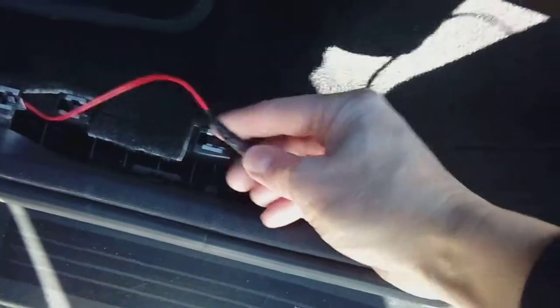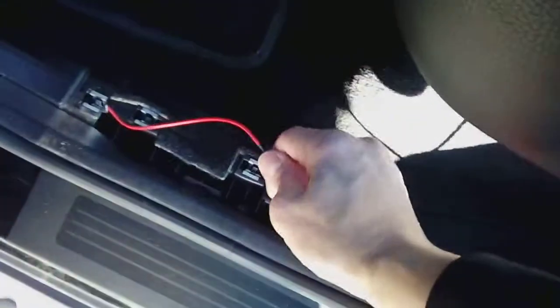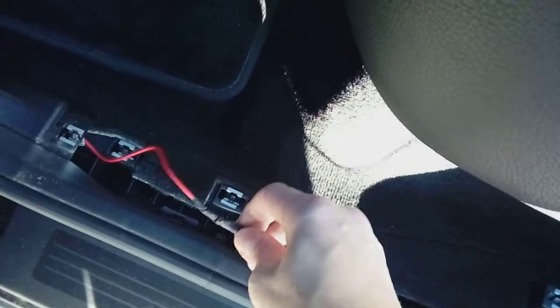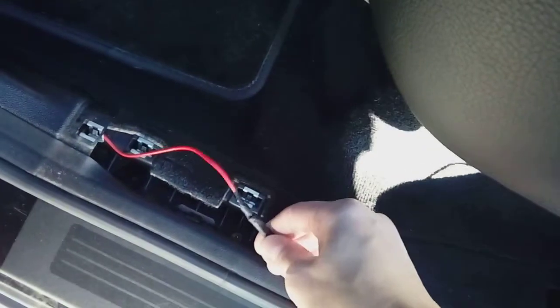We've bullet-connected — or you could solder — the extended power cable together. We're now at the side of the rear seat. We've removed the little plastic sill trim; be careful as the lugs can snap, so pop them up very carefully — they're quite a tight fit. We've electrical-taped all connections. Never be tempted to just twist wires together — I've seen a car fire happen from that; it's not pretty. Use bullet connectors or solder and heat shrink. Leave the power cable under the metal spring clips and proceed to the rear fuse box.